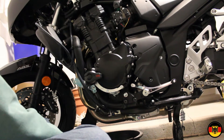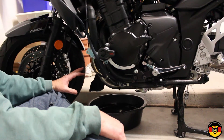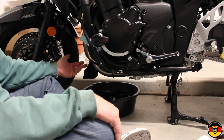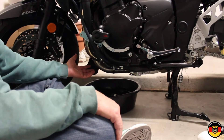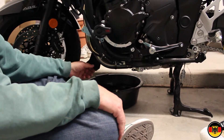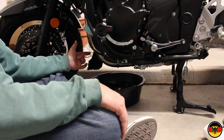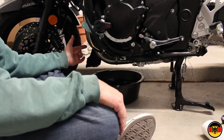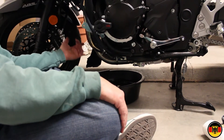You may also have to use a strap wrench for this operation. We have the filter loose enough now to where it's starting to drip oil. I don't know how Suzuki comes up with these designs — on our Grand Vitara it's practically the same thing. The oil drips down all over the exhaust pipes, so I'm going to have to clean them really well with clean wipes and alcohol to get all that oil residue off. This is a real bear of a job. If you take it to a shop, unless you're really comfortable with your mechanic, I'm guessing most mechanics probably just blow this off and don't even change the filter. So I'm going to make sure I do this right and change the filter.